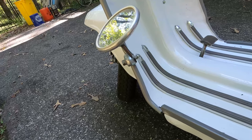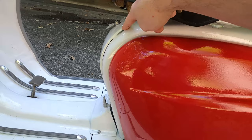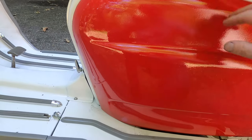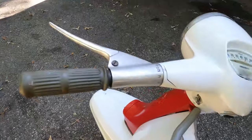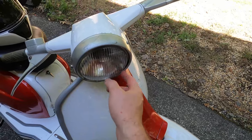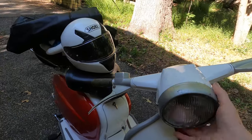Clearly I did not get all of these torqued down — this rattles a lot. We've got some new rubber standoffs for this door that should hold it taut so it doesn't flap around and open. We've got a new fixing kit for the horn casting — I've got temporary bolts in here, these aren't stainless or anything, so we want to replace those as soon as we can. There's a rubber gasket in here that was completely disintegrated when we took it apart. I've got a whole new chrome piece and lens and all of that coming from Scutopia, so we're going to replace this whole thing.